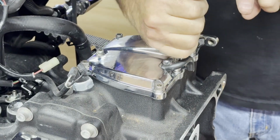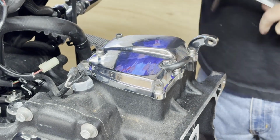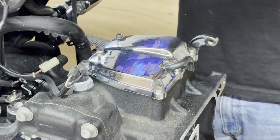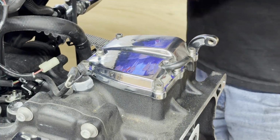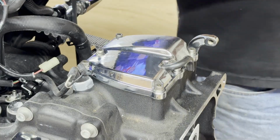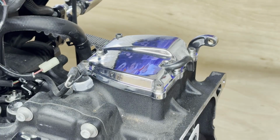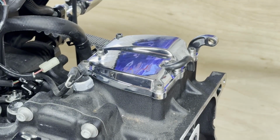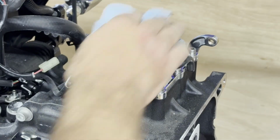I know I could go look up the torque specs and all that, but I know they're probably going to say about 90 to 120, maybe not even that much, inch pounds, not foot pounds, inch pounds. And putting the stainless into aluminum, I would almost knock 10 or 20 pounds off that figure. You can look up those torque specs. I'm sure somebody's got them somewhere online.